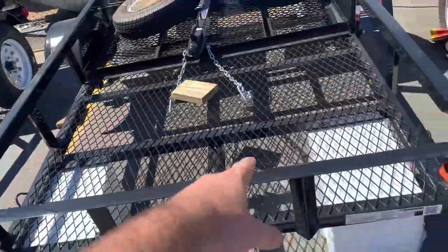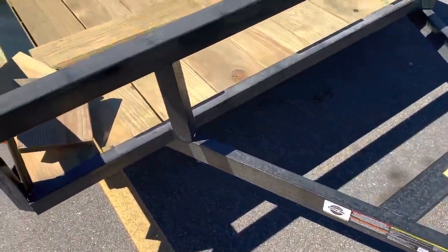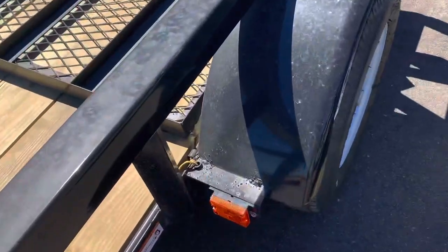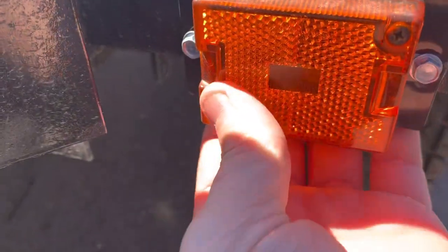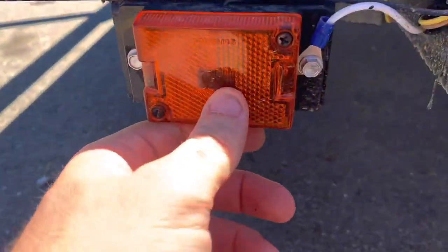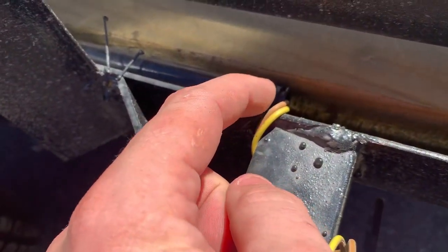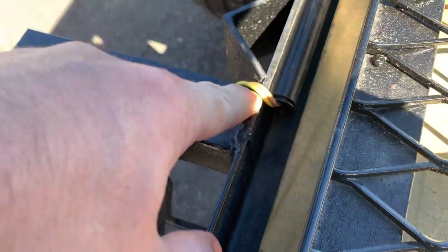This is a 5x8 and that's a 6x8, and the price difference is considerable. They do go to a V-groove tongue, but you've still got poor welds — slag buildup and splatter everywhere, just painted right over. That's really poor workmanship. The lights are not LED; they're bulbs that'll need to be swapped out periodically. And see that ground wire? That's going to rust and give you problems down the line. The wiring is also routed directly over the angle iron frame.